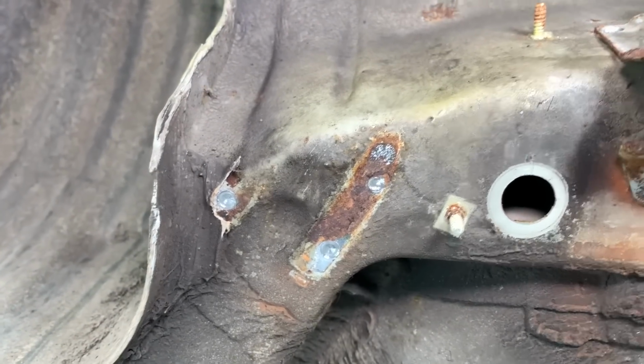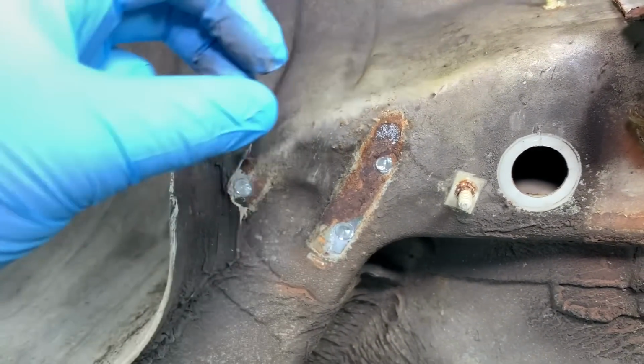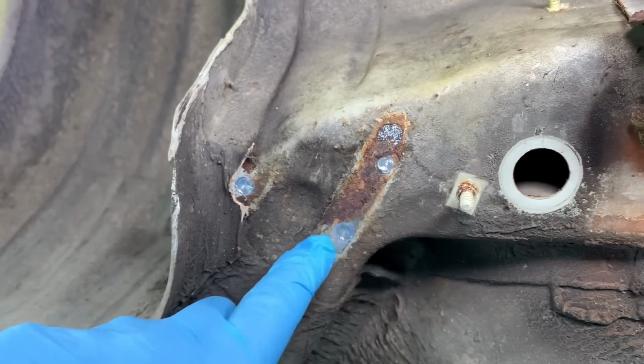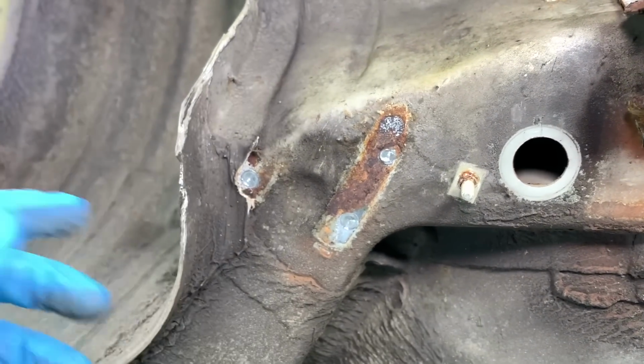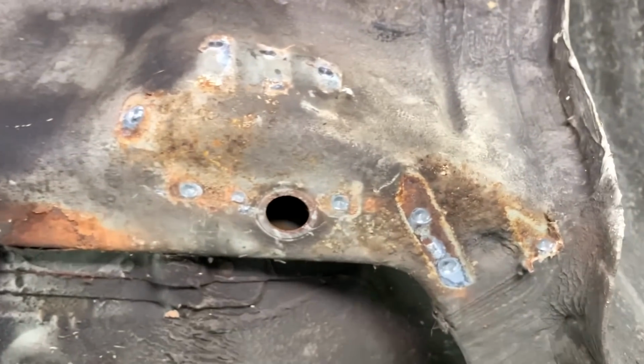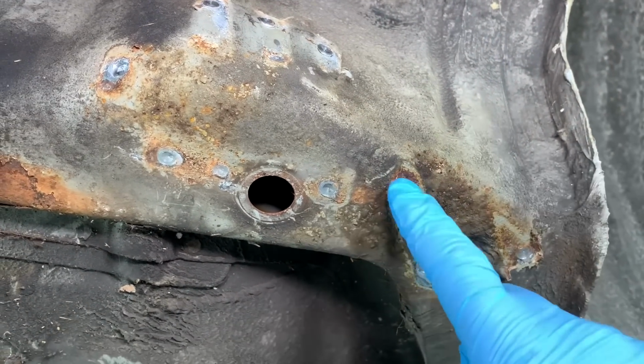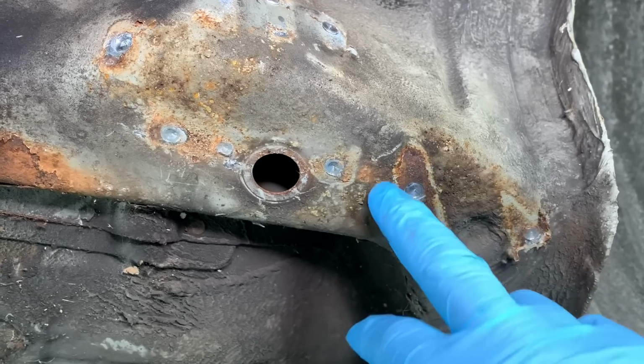When that was spot welded on at the factory and the E-coat did not get in between the two tightly touching panels, it stayed bare metal, and obviously you get moisture over 18, 19 years, it's going to corrode, isn't it? So that's what we are getting out and replacing with the Redish Motorsport brackets. Same on this side, that brake pipe bracket's pretty nasty. It's gone now, so we'll take care of all this corrosion bubbling under there as well.